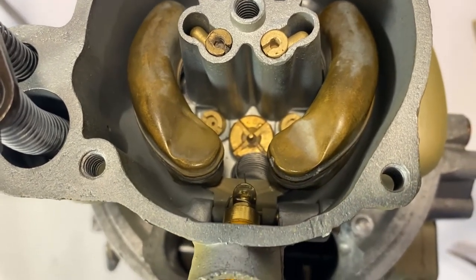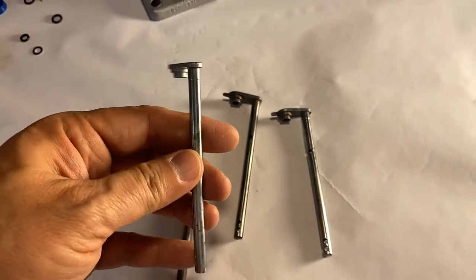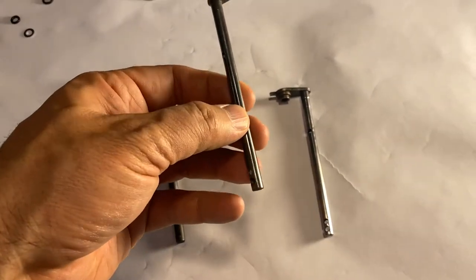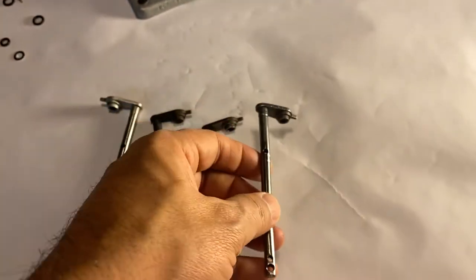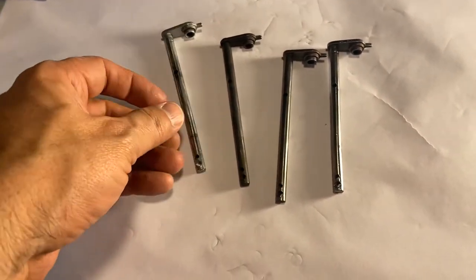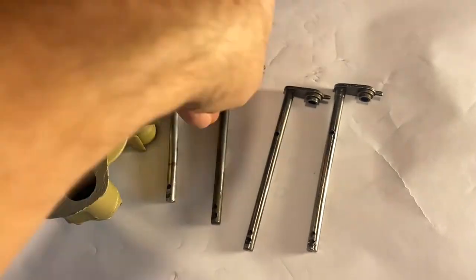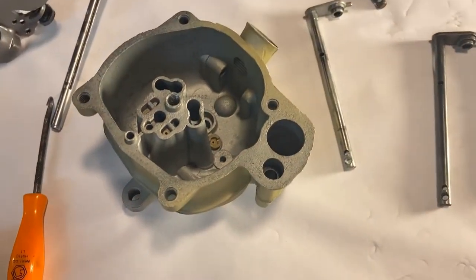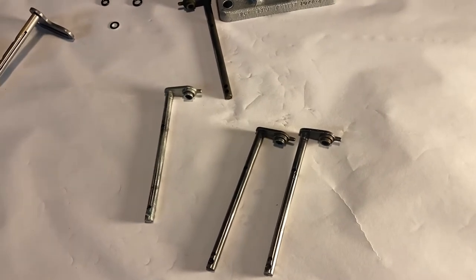When you look at this and its action, there's a tendency for that spring to creep. Something else worth mentioning as you're going through cores — be careful about these accelerator pump rods. These are hollow and very easy to bend. When you're trying to take one apart dealing with parts that have frozen up over time due to corrosion, be careful that you don't bend it. If you've got some cores lying around and you're just not paying attention, make sure you put one back in that's not bent and that the shaft is straight. Easy check is to put it through the bore — it should just go through pretty freely.